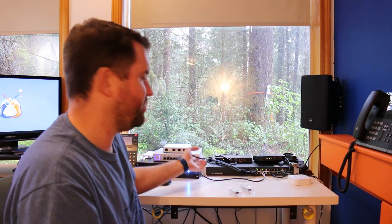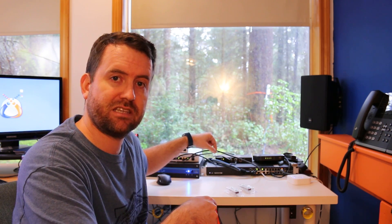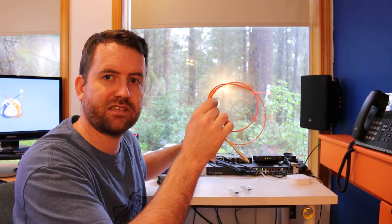I'm also going to have a persistent ping running on my desktop that I will put up on the screen. My computer is plugged into this UniFi switch, and my internet is plugged into this EdgeSwitch. So when I disconnect the cross connect — that's the ethernet cross connect currently running between these two switches — I'm going to see my persistent ping drop and start losing packets, and then it should come back up once I plug in the SFPs and the fiber patch cable. So let me zoom in and let's get started on the next part of this video.